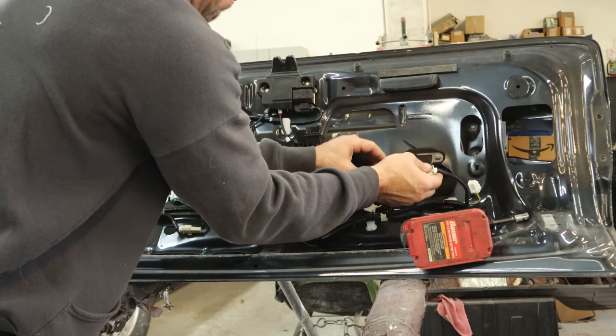Pull out our rubber baby buggy bumpers and now we're over to our actual bumper. We saved some brackets when we took the bumper off of the junkyard because we're going to need them — now we need to take them off our bumper. We'll take our reflectors out of the way; just one screw and they clip in, so we'll pop them out of there. This was an Indiana car — not quite as rust-free as our Texas car, but not quite as bad as our Illinois car. Now we're going to pull these little plastic pieces off. They really serve no purpose, maybe just to stiffen the bumper, but they're held on with two screws. And we don't need to take the clips off because the bottom of the bumper is a different color, so the painting gnome's not going to paint that.